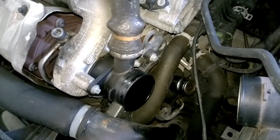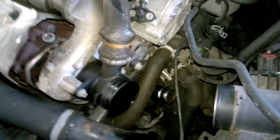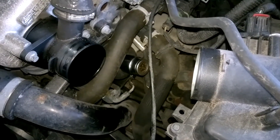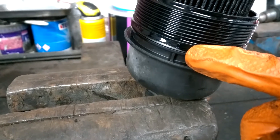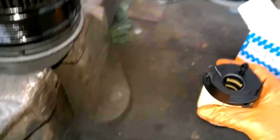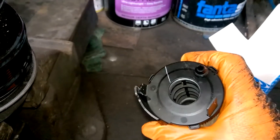The oil filter is located just down there. I'll be taking off the air intake pipe to make enough room to get at the oil filter housing. With the air breather pipe out of the way, there's much more room. It's a 27mm socket with a half-inch drive I'll be using to remove it. This breather pipe was held on with flathead jubilee clips.